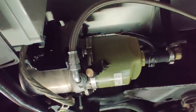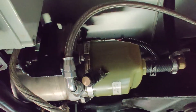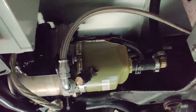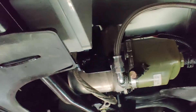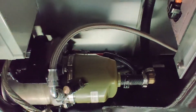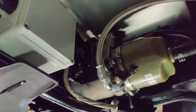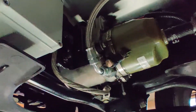Once I fill the tank from above with fluid and make sure all the air that might have been trapped will escape through the hose up to the tank, I run the pump for a few minutes to ensure no additional air is being sucked in from the steering rack. Then I'm able to reinstall the pump back in this orientation, and it's been working perfectly fine — I've been using it like that for a few months with no problems at all.